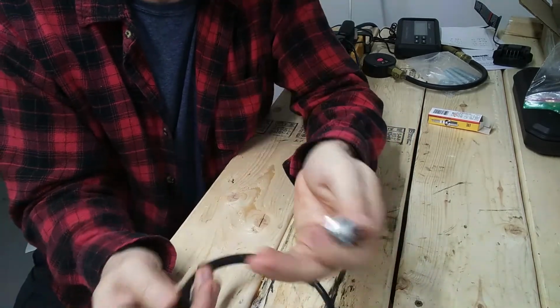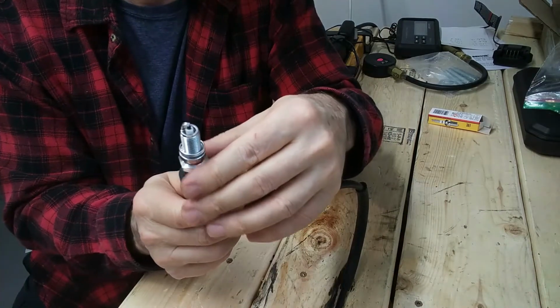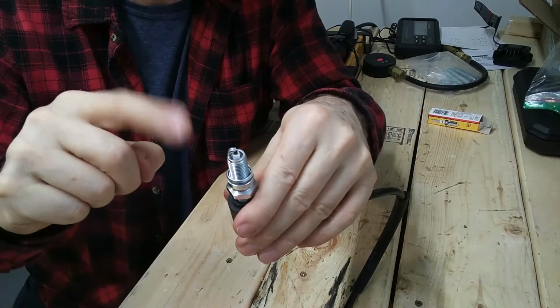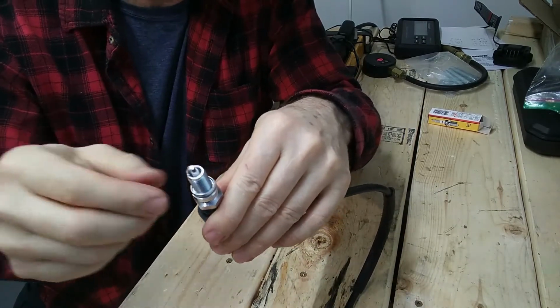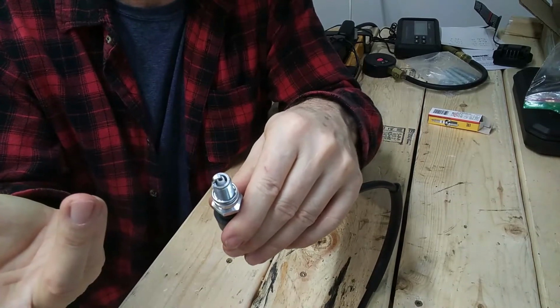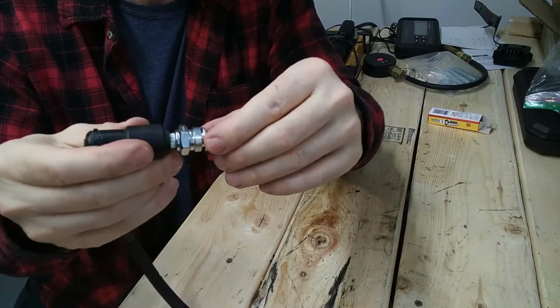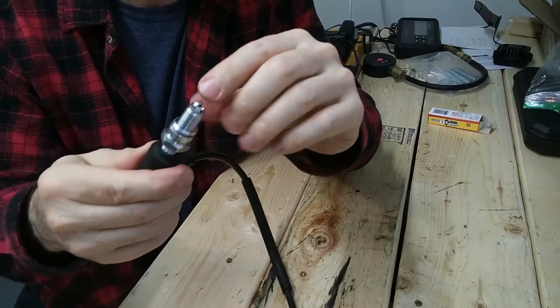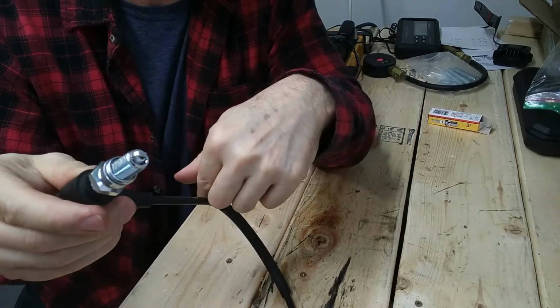Anyway, get a spark and just pull all the ignition wires off. It often has a crackling sound like electricity. And it has a kind of motion like this, pretty quick, because it's firing as the RPMs are going, whatever RPM the motor's turning over. So it's trying to start, so it's doing its best. And if you don't have either one of those, like if you have a yellow spark or something like that, there's definitely some issue in the ignition circuit.